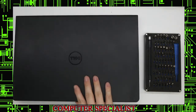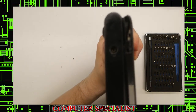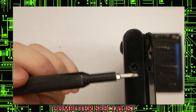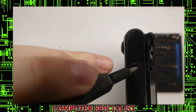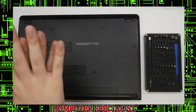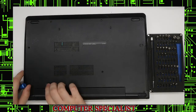If we take a look at the charging jack here, it is completely broken out. You can see the middle pins, which is what the charger uses to sense information — the one-wire circuit — and the pins holding it in are completely broken. That's pretty common on this model because it has a design flaw in the hinges, and the hinge rests up against the charging jack and presses up against it, so when the hinges break, the charging jack usually goes with it.